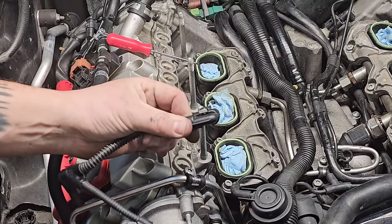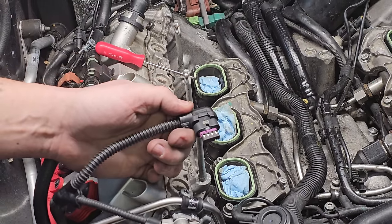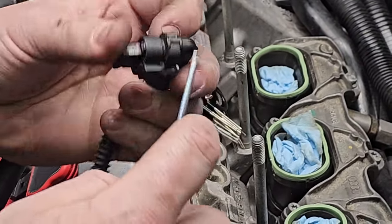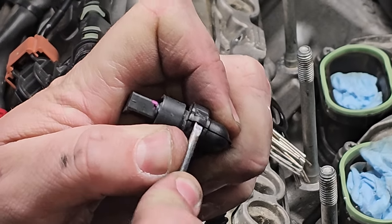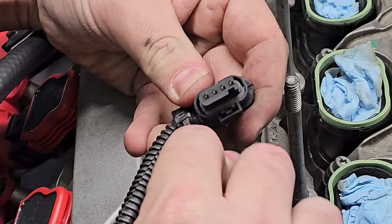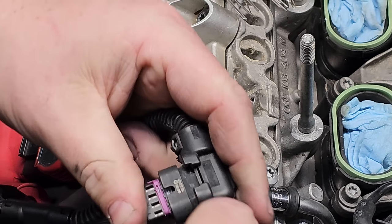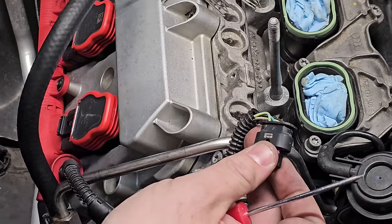Since the MRA 1900 runs three-bar upgraded MAP sensors and not your OEM ones, we have to repin the actual wiring harness for your MAP sensors. That sounds daunting but it's not too bad. First, remove this housing off the harness — there are two very small clips on each side. Gently pry one up, go to the other side and do the same, and it opens up so you can pull it completely off the wiring harness.